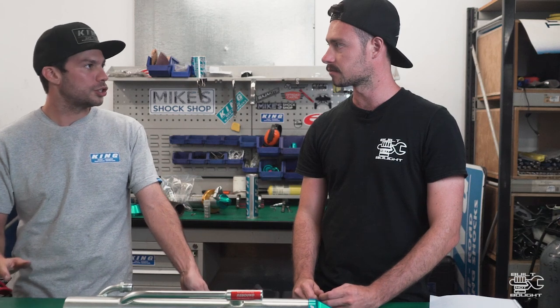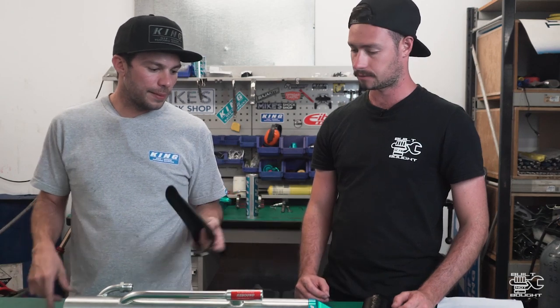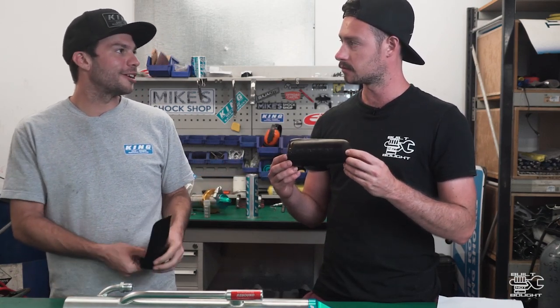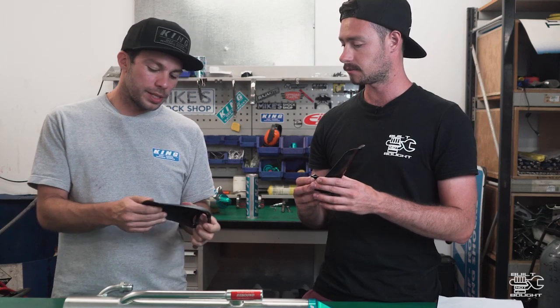If you have that exposed shaft, sand, fine grit, rock - anything is going to smash into it and start pitting it. We can polish shafts and make them better, but once they start getting damaged you start changing seal kits a lot. You're better off just spending the extra $150 or $200. Fox, Old Man Emu, King - they've all got a roost guard option, and it does work, but does it work enough to satisfy warranty needs? We won't warrant a shock absorber unless it's got a rubber boot. The roost guard is not full coverage - it's not going to do the job a boot would, and a big enough rock is going to make a mess of it.